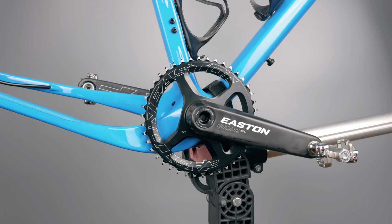I remember the bearings being pretty stiff before I pressed it into the frame, but I figured that would just loosen up after riding it a bit. I don't know if that was a faulty bottom bracket from the beginning or something went wrong when I pressed the bottom bracket into the frame. I will just assume that it's my fault and get on with it. So much for not having any problems with Pressfit bottom brackets.